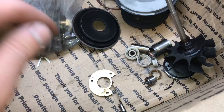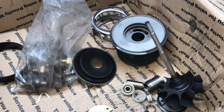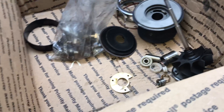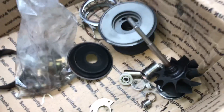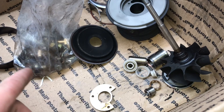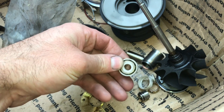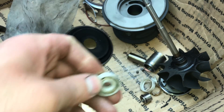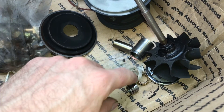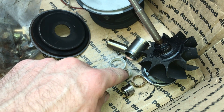So it's all one piece. This was the internals of a GT35R from some random company that sells them on eBay. I'll just point out the differences in this one. You can see the internals of the ball bearing cage, but it's completely different — it had two separate races. This one just came apart.